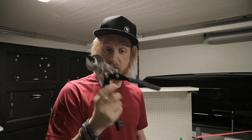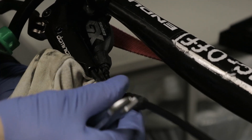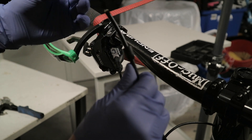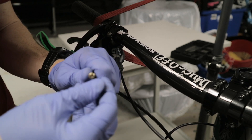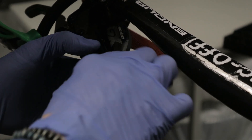Let's start installing the front brake. For cutting the hose you need a good hose cutter because this hose is made of Kevlar — your grandpa's old toenail snippers aren't going to do the job, you need a proper hose cutter. First we need an 8mm spanner. First comes the rubber boot, then the compression nut — I think it's also called an olive. An important thing with this brass nut is that it has to be pushed in 3 millimeters, and then we just start screwing it in.